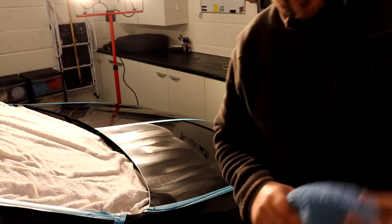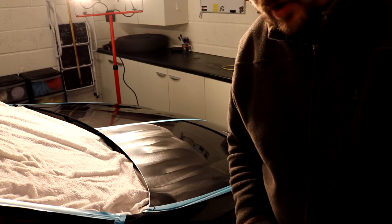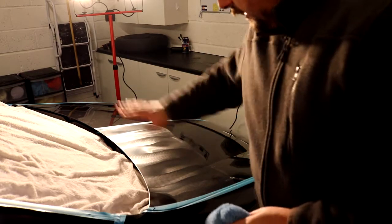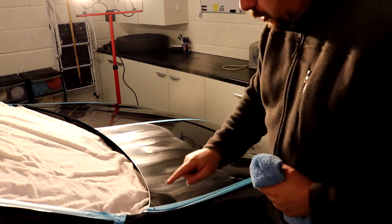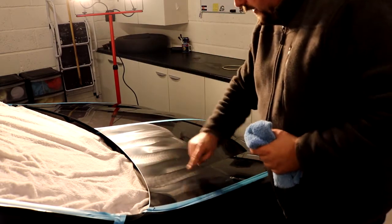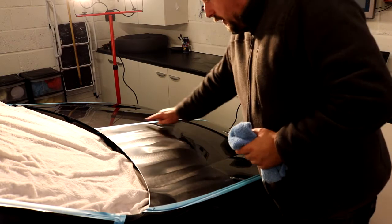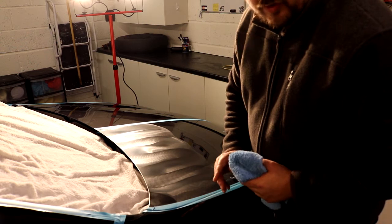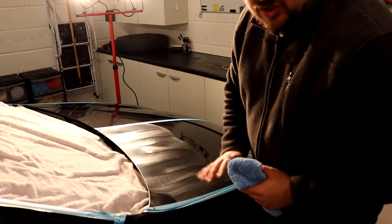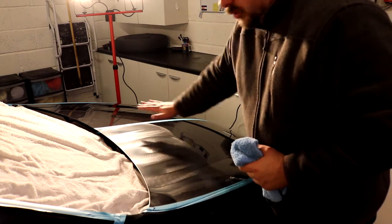Okay. So I think I tried to stay as close to about 2 minutes there. I think I got up to six passes or six crosshatch runs. So you noticed we were doing what's called crosshatch, where you go across first horizontally and then you change direction to go vertically. And each time you overlap by around about half the size of the pad. That will give you a consistent coverage over the piece that you're working in.